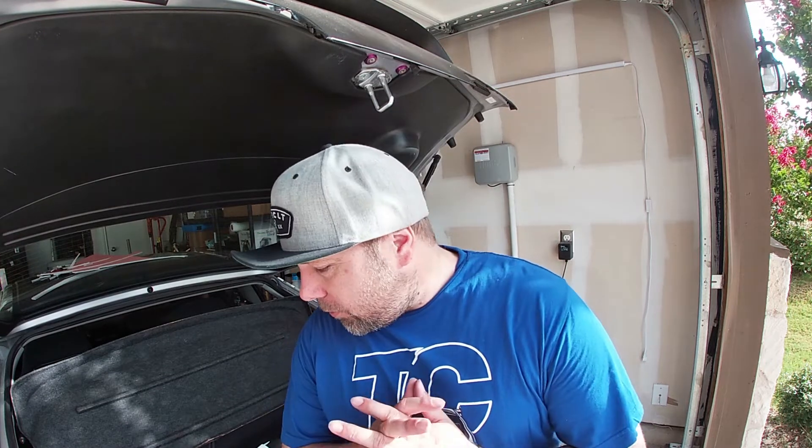So I'm going to go between the tank and the manifold to protect my manifold. You can put it between your compressor check valve and the tank to prevent any water from going into your tank — a lot of people do that, and I've run that setup before in many trucks. But in this one I want to protect the manifold. The manifold is one of the most expensive parts; if I have to replace or tear it apart, you're down for a day. A tank, if you need to replace it, you're down for about an hour. If you get any debris into your manifolds — those have diaphragms and O-rings — that dirt, debris, and water can dry them up, crust them out, and you're going to have a leak. If it gets past your manifold into your bags and you have a bag-over-strut style, those little O-rings can go to crap. So use the insurance policy of a water trap. There's no one set standard of where it needs to go — it's up to you.